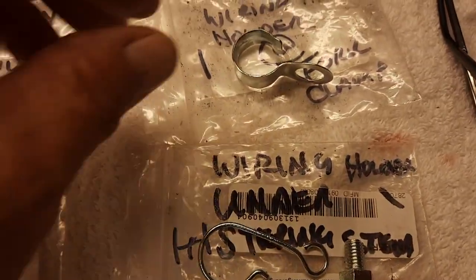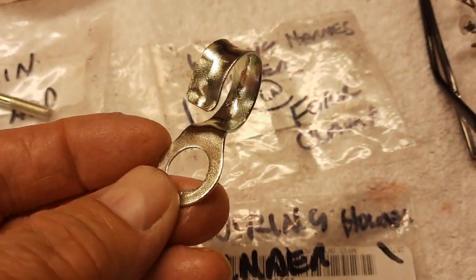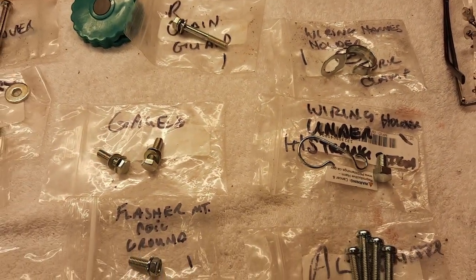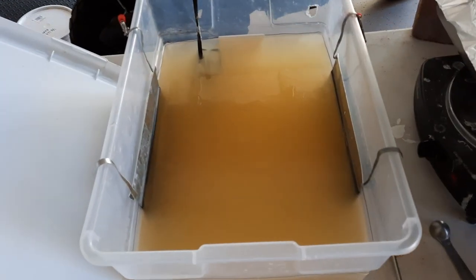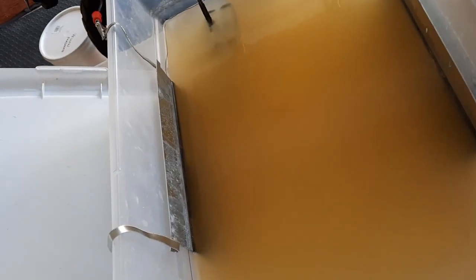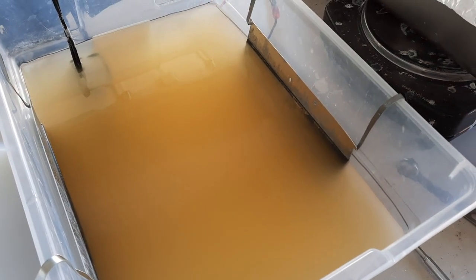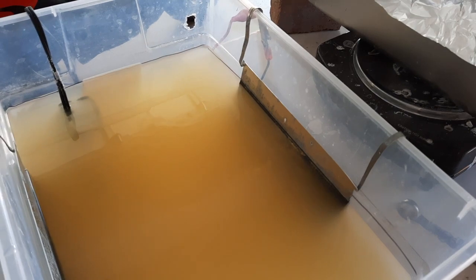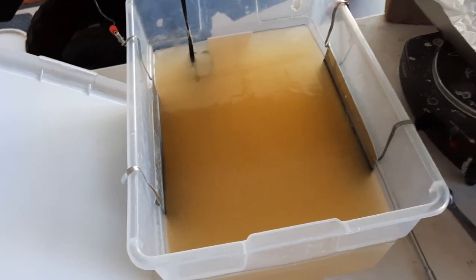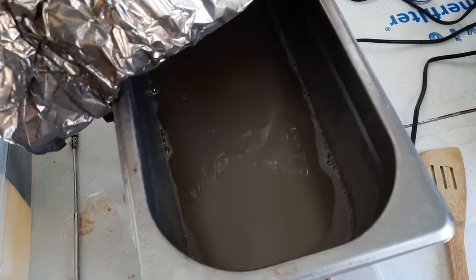So I'm excited because for the last 2 months I've been struggling with this plating, and it was working perfectly. So what it was most likely the pickling juice or the pickling bath. And it could have been my plates were just about gone and there was nothing left to them other than maybe like a corroded little bit left. So the new plates and the new pickle bath, I think was what they call that. I even did a new, complete new degreaser.